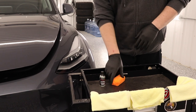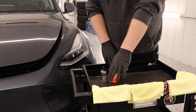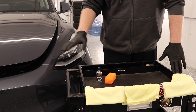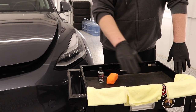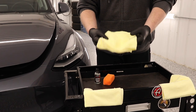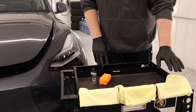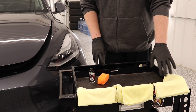Once you've got that, you've got your applicator pad right here. We've got three microfiber towels — towel one, towel two, towel three. Towel one is going to be used to level the ceramic coating after we've installed it. Towel number two we are going to use to remove any excess ceramic coating. Towel number two is also damp — I feel like it does a better job of removing excess ceramic coating. Towel number three is just an insurance towel, literally there to make sure you wipe up any streaks or smears that may be left behind.